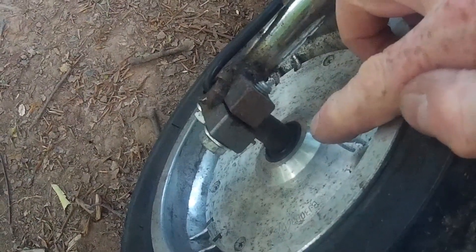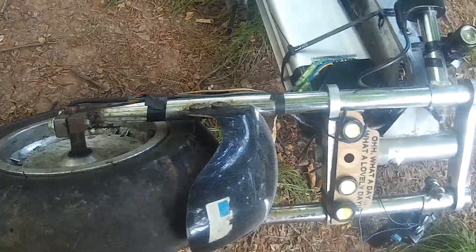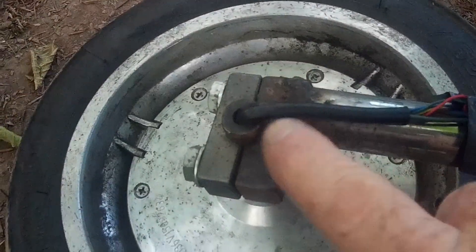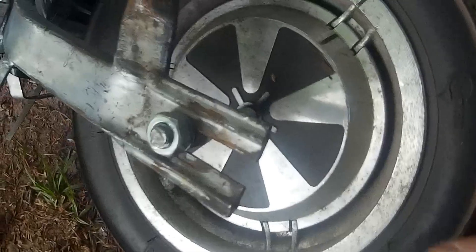Hoverboard wheels are normally held on with one axle on one side with a clamp, which I've reproduced here on the bottom of the fork. But the thin spindly fork leg can't take a side thrust like that. So what I did was take the hoverboard motor apart and put a bit of 10mm studding in — that threads into the back of the half shaft, because the back half is free to drill into. Obviously this side has the cable going to it, and then this side bolts on in a traditional manner. And I've repeated that on the rear motor.